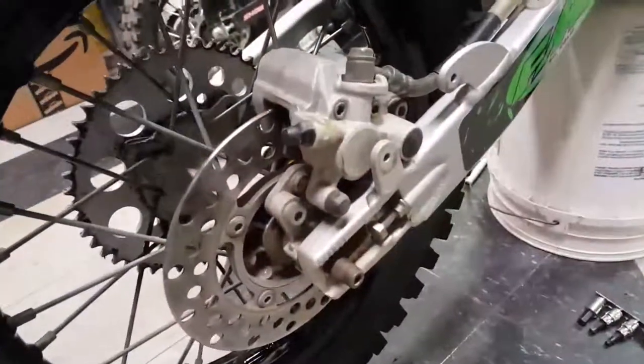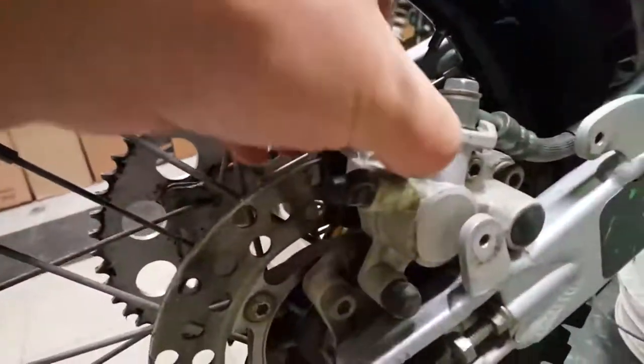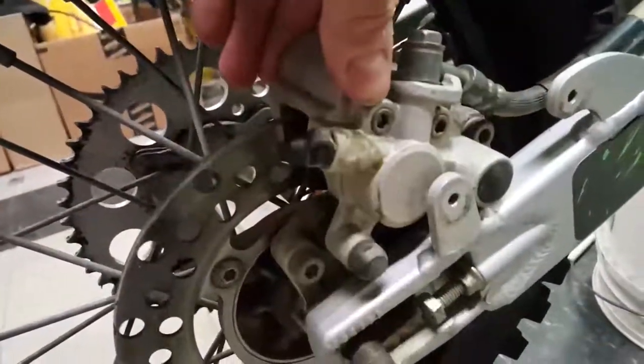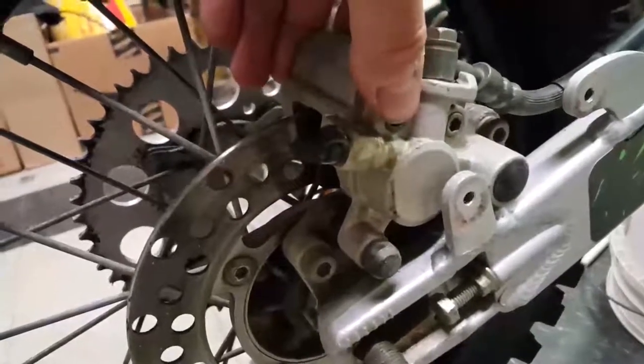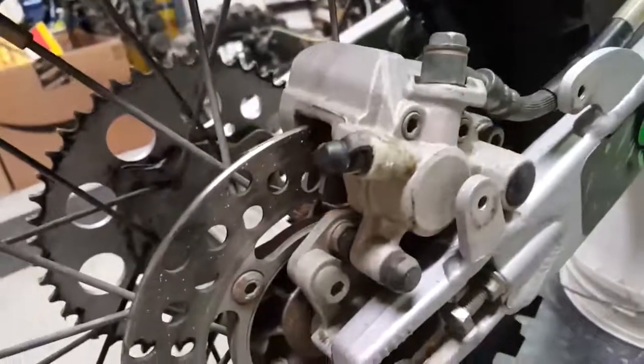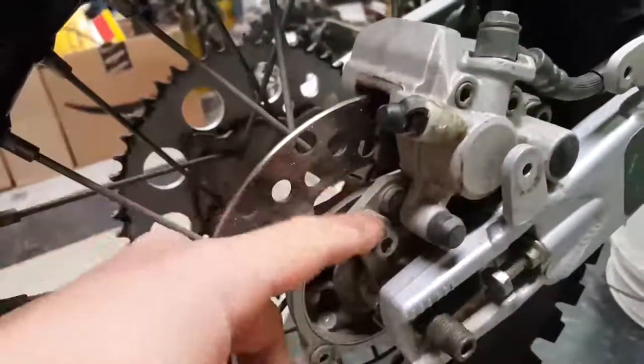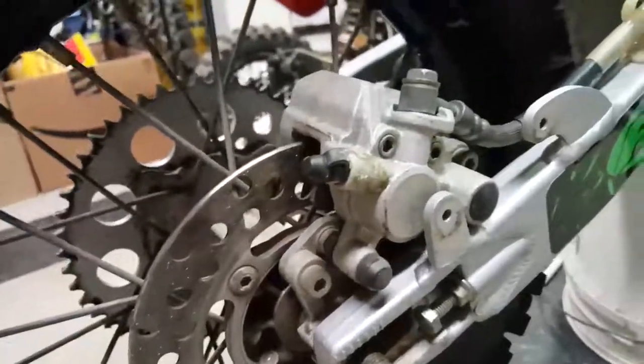Once we get our caliper guard off, we're just gonna loosen up our brake slides with these two pins right here. Get an allen screw and you can pull them out or just loosen them, but you want to do it before you take out your main bolts here and here. These might not come out if you're holding the caliper in your hand, so use the leverage of having it bolted to the bike — break these loose and then take these ones off.